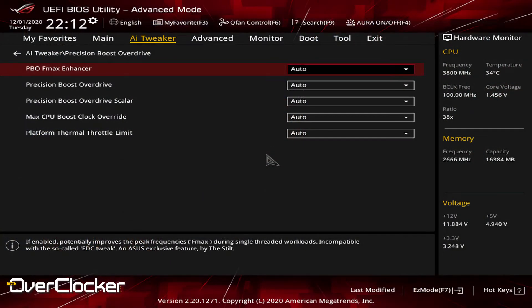I tried everything that supposedly boosts performance on this motherboard. There are a few PBO tweaks in the sub-menus in the AI Tweaker, but none of them really helped me do anything I wasn't already getting before. The long and short of it is that just using a manual OC — setting a fixed clock frequency and the required voltage — you don't really have to mess around with ASUS multi-core enhancements or any of the PBO enhancements in the AI Tweaker sub-menu. If you're going to do anything to improve performance, it's all going to come down to the FCLK and the DRAM frequency. These options may have a function in future, but right now they don't add much — in fact, they can actually reduce performance if you tinker too much. So I would just leave them as they are.